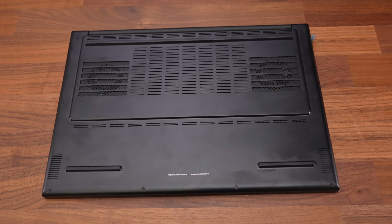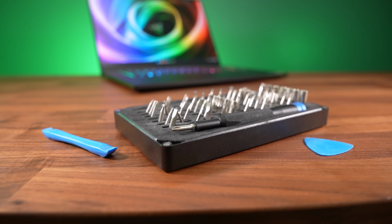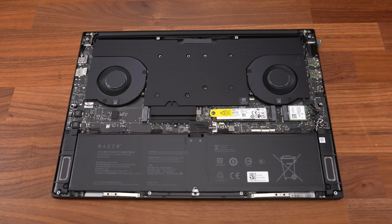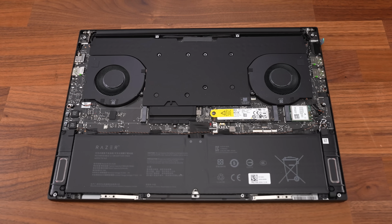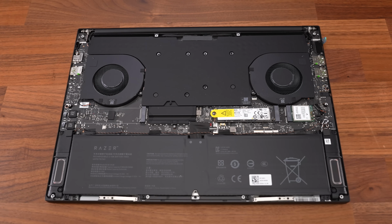Getting inside requires taking out 10 small TR5 screws, all the same length. I didn't need any tools to pry the bottom panel off, but my kit does have the TR5 screw bit, so I'll leave a link below if you're after good laptop opening tools. Inside we've got the battery down the front, installed PCIe Gen 4 M.2 SSD above on the right, a secondary spare M.2 slot to the left of that, and the Wi-Fi 7 card on the far right.